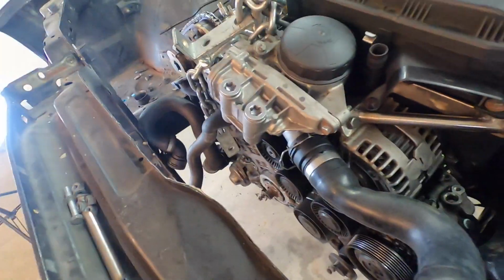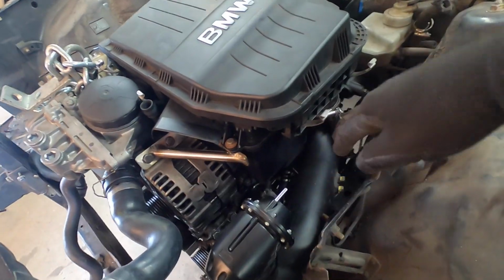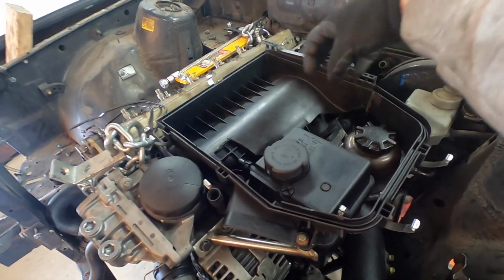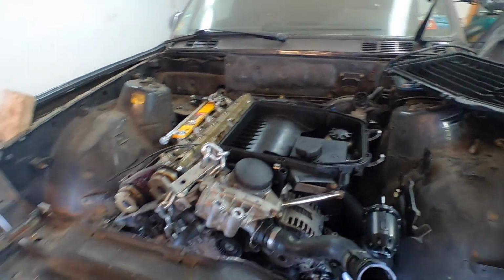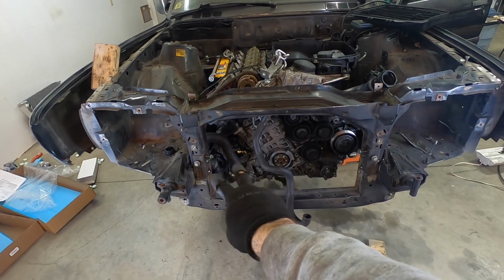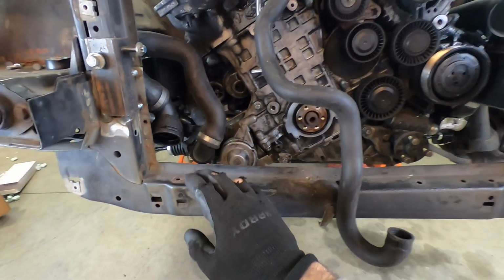the heater core. Now that other lower hose that I was telling you about, not the lower radiator hose, but the lower thermostat hose, actually branches off and goes into the outlet of the coolant reservoir. So it's a T that's going to end up happening underneath here, and it's going to be going straight here to the heater core so that the car actually gets heat. So let's focus on one hose at a time and see how we can route those two heater core hoses over to the underneath, right? Well, actually just the one, just this guy.